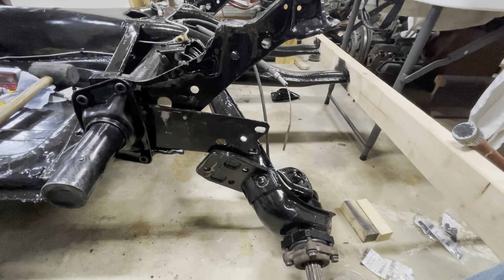You can see how that moves side to side — there's a little play in there and also in the plate. That gives you the ability to adjust your alignment in the rear. If you're going to get your car realigned, that's a good idea, because even if you keep your alignment where it was, you're going to change your suspension geometry by lowering or raising the car. That's going to change your camber angle — the way your tire tips in and out relative to your spindle — as well as toe-in and toe-out. All of that changes when you raise or lower your car.